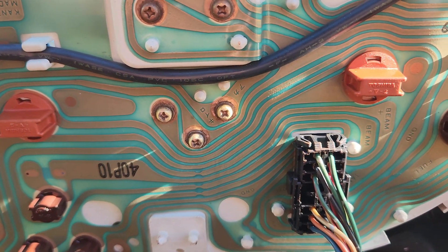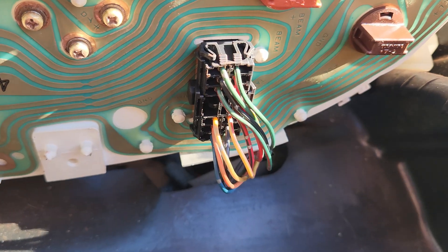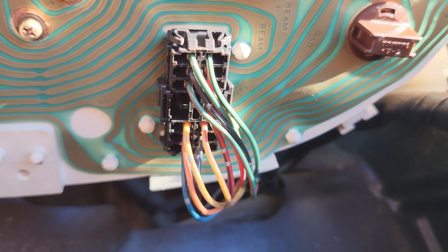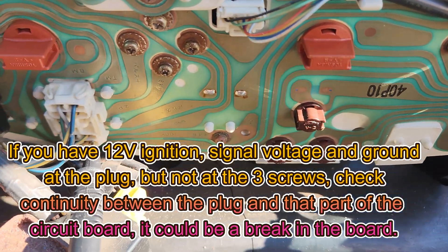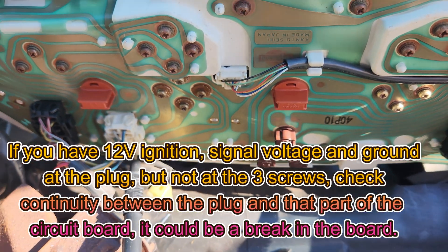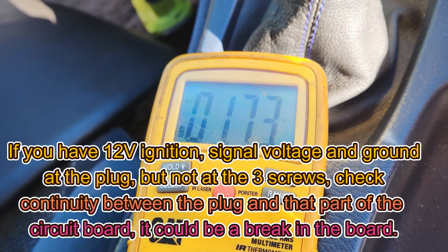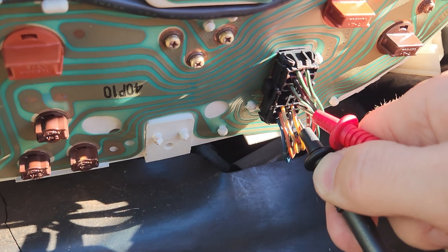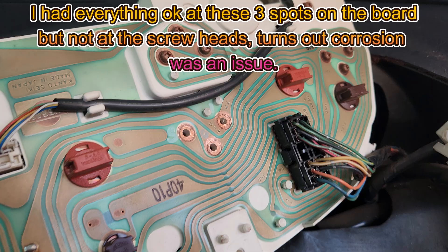We can now roll the cluster over and see the three plugs that are supplying it with power. These three bolts hold the tachometer in and also supply it with power and signal. The power, signal and earth all come from this plug and they all group together in the bottom right hand corner. Here we are making sure we see that same voltage signal making its way to the cluster. I have a ground and I'm checking the signal wire with the positive side of the multimeter. We see we've still got 1.7 volts and as we rev up the car that voltage still increases exactly the same way it did at the diagnostic plug. We can also check to make sure the ground is correct — the signal and ground in the same black plug and it is working perfectly.